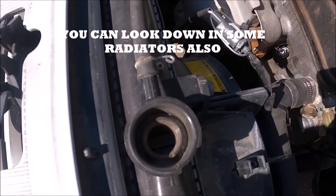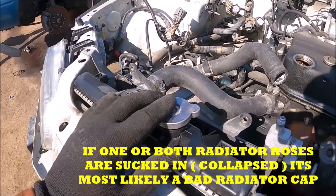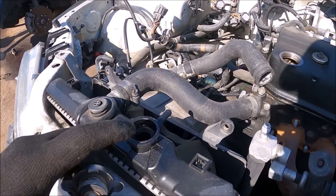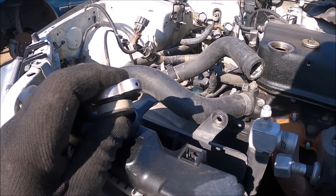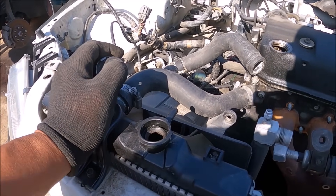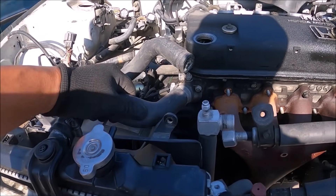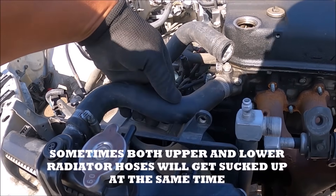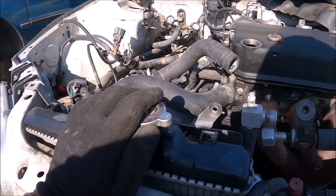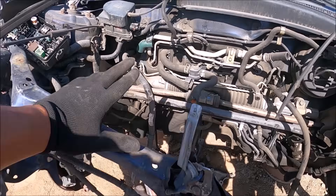Sometimes you can see the water flowing when you look down in there — that'll also tell you if your water pump is working. If your hose is sucked in, that means you've got a vacuum in the system and your radiator cap is bad. There are two seals on the cap — one seals each section. The system operates under a certain pressure. When pressure builds, the cap opens and allows coolant into the overflow reservoir. When it stays sealed and can't release, the system creates vacuum and the hose gets sucked in. These caps typically operate around 14–18 PSI depending on the car.